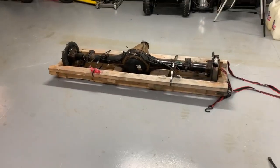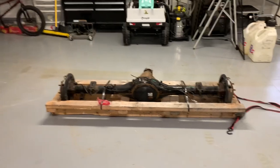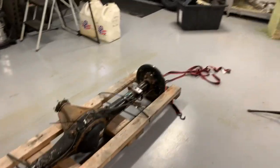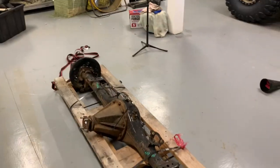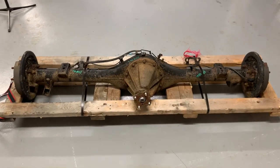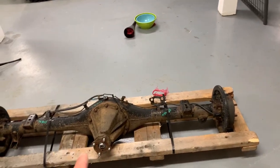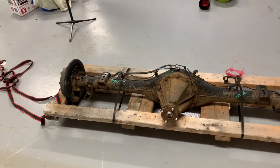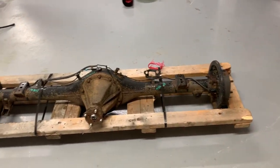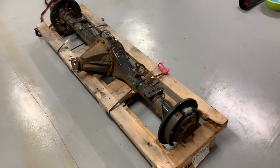Here it is - this just delivered today. This is the 8.75 rear end from a manual transmission Tacoma. I have an SR5 so mine came with the 8-inch that the previous generation Tacomas had. This is the 8.75 which comes in the TRD Off-Road and Pro, and also all manual transmission Tacomas. The difference with this one is it's an open 8.75, which is like two grand cheaper than the TRD Off-Road or Pro - this is just from a base model manual transmission Tacoma.